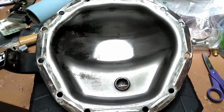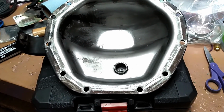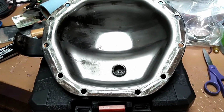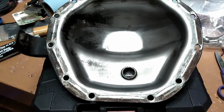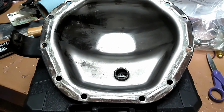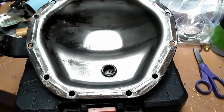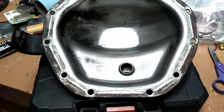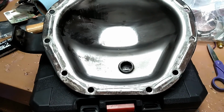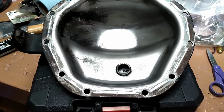And so I went ahead and painted. That is a primer and paint in one. I cleaned everything off with brake clean real good, hit a couple spots with some sandpaper and a little bit of wire brushing to clean it up to hopefully promote adhesion. After I had cleaned that, I put 2 layers of just black, which was also a paint and primer in one.